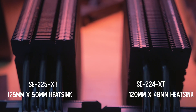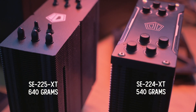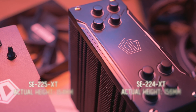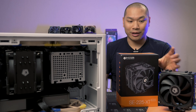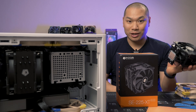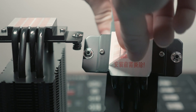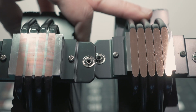This is particularly helpful for denser heat fin arrays where the synergistic effect of having two fans would be very pronounced. The heat sink in this cooler is a little bit wider and also heavier at 640 grams. Height-wise, it's supposed to be the same at 154mm as the SE224XT, but perhaps due to manufacturing tolerances, I found the SE224XT to be ever so slightly taller at about 156mm. One of my theories with the SE224XT being so good is that in addition to high quality base plate machining, the position of the direct contact heat pipes was very opportune. There are some changes in this new base plate, but it still has very high quality machining.